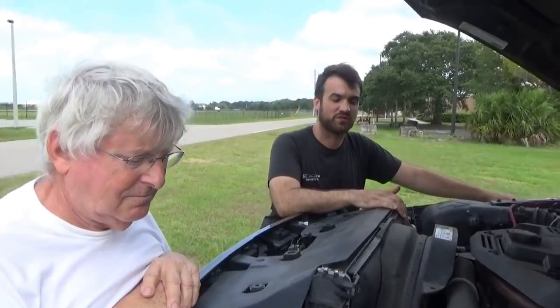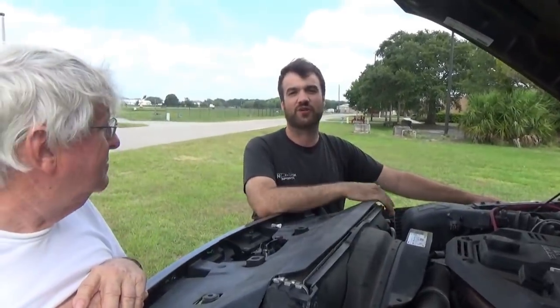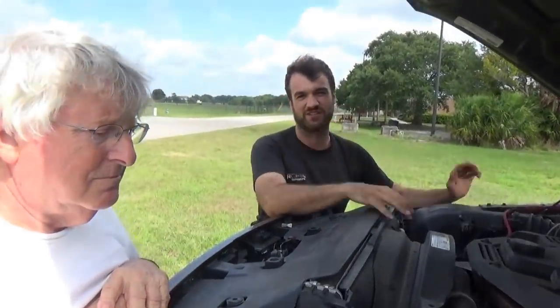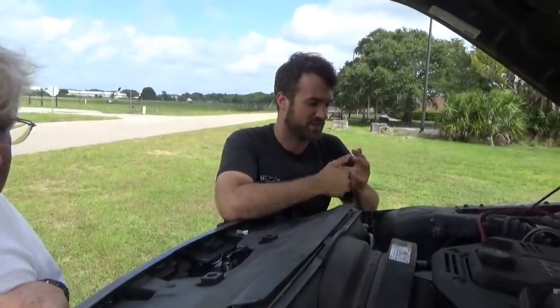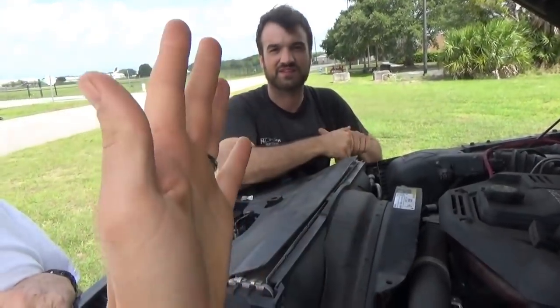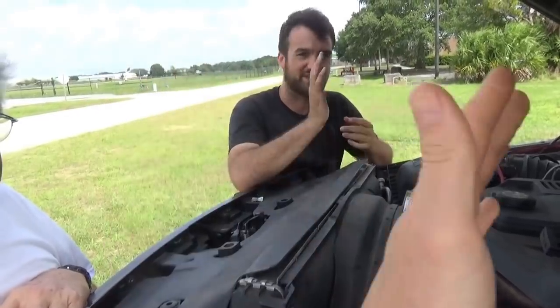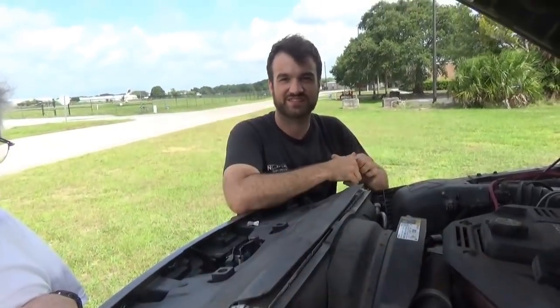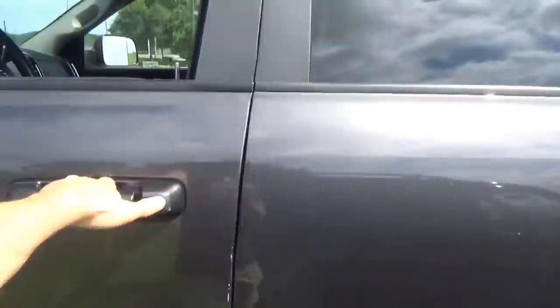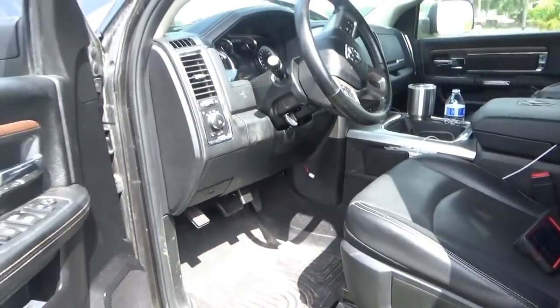So then it kept going down. When I got to my parents, I put the batteries on chargers to charge them up and went straight to the dealership. I gotcha. All right, so you had one episode, like half an hour, where the voltage is dropping, then it recovered. Yeah. Then it actually started going down again, and then you made it home. Yeah. Okay, so almost an intermittent problem, but the new alternator, once it quit, right?